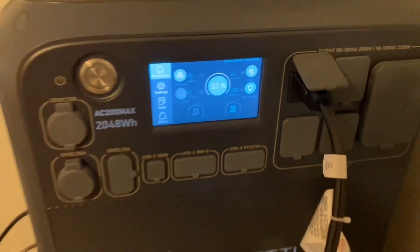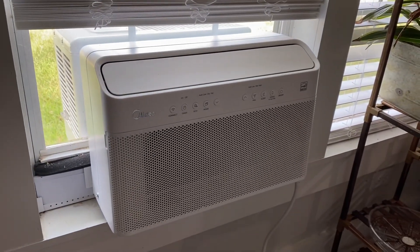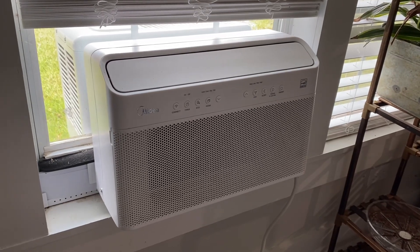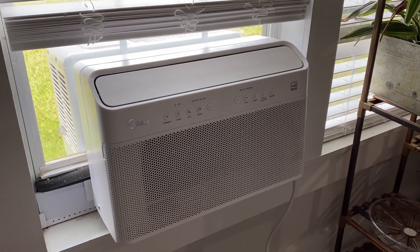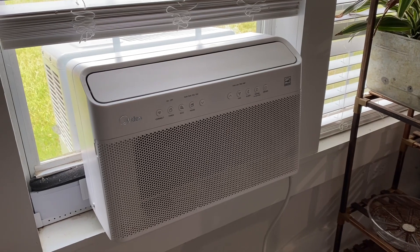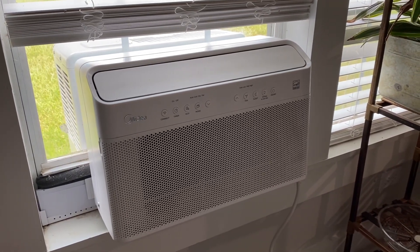Thank you for taking time to watch the video - hope you enjoyed it. One more thing about the air conditioner: this is the Midea 8000 BTU. Different brands and different sizes are going to use different watts. The most this one was pulling was about 950 watts, and the room I have it in is a really large room. It keeps it cool but it doesn't cycle like it should, so it never gets really cold - it just cools it off. A smaller unit I have for the bedroom I could run all day and still be at 100% charge by end of day. Smaller units use less watts, larger units use more, and different brands vary - the Midea actually seems pretty energy efficient.